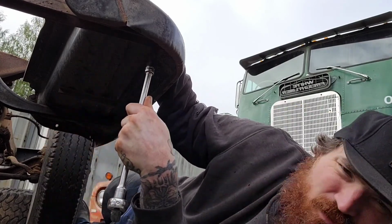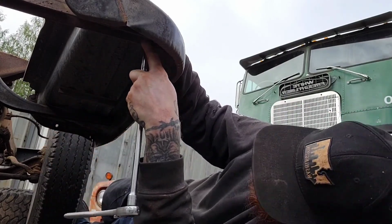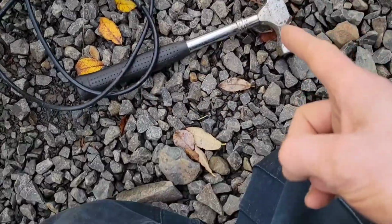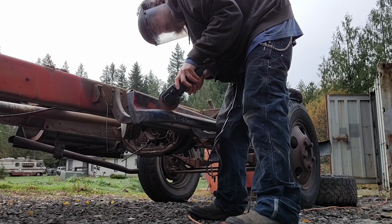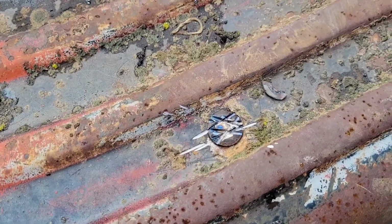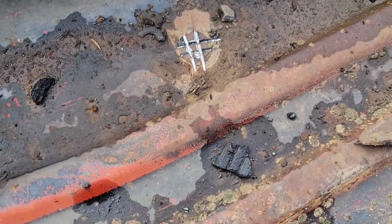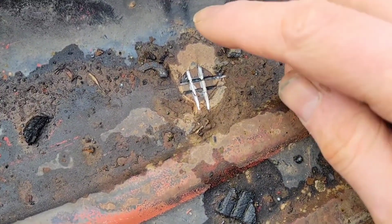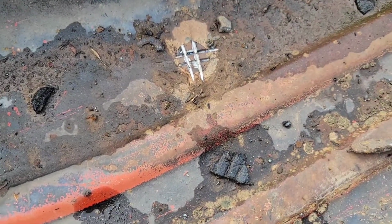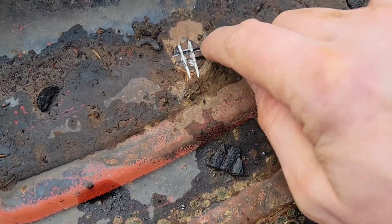Yep, they went to spinning on top like I thought they would. I'm gonna be uncooperative. We'll use the cut, slice, pick, pry, and pound method. I usually go kind of crisscross and try to hit about where the shank of the bolt goes on the other side of the head. Try not to get too much into the metal around it.